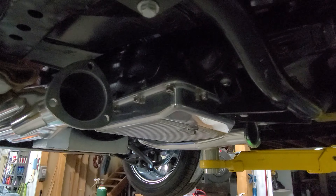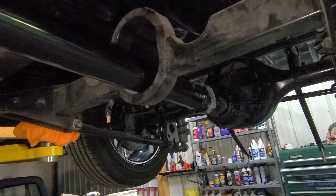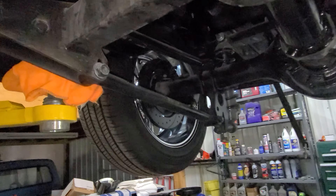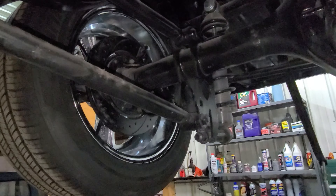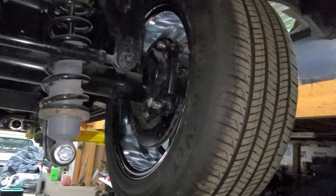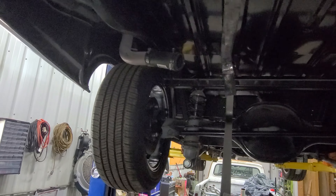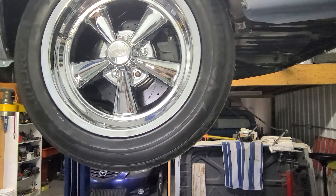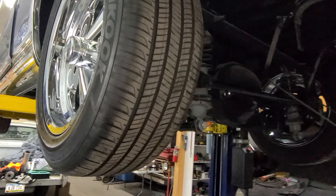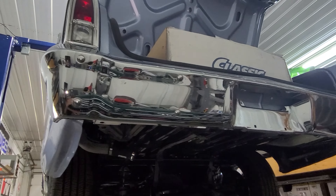The transmission is a Turbo 350, it's a Stage 2 - you'll see why shortly. There is a driveshaft sitting in here. It's also got a Ford 9-inch with a four-link rear suspension kit, also from Yogi's, with the matching Wilwood brake setup in the rear as part of their kit. I do have the gas tank removed and I'll show you why shortly. It looks like it's running a 235/55 on the rear - not too wide but it fits up in there nicely.